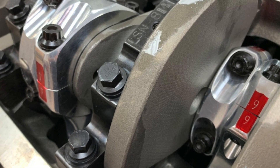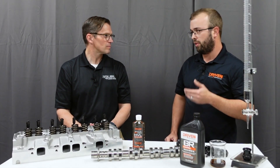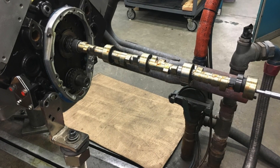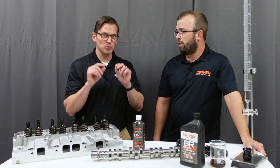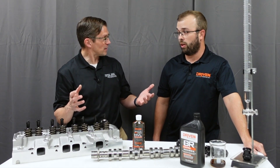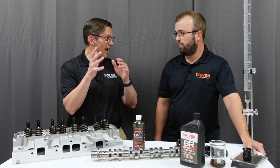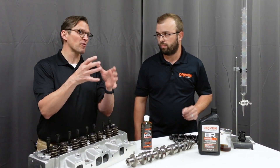That's what this HVL can provide. The grease is perfect for cam and lifters, push rod tips, rocker arms, things like that. Use it in moderation, because we don't want grease getting in the cylinder wall, because that will fill up those peaks and valleys and ruin your surface finish, which is critical to ring performance.